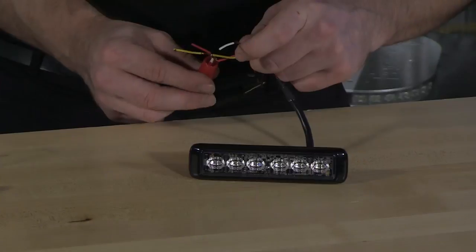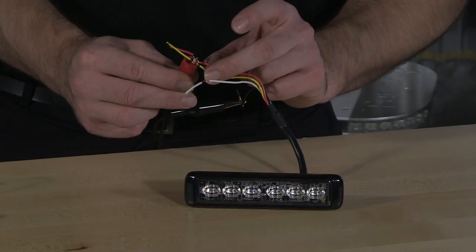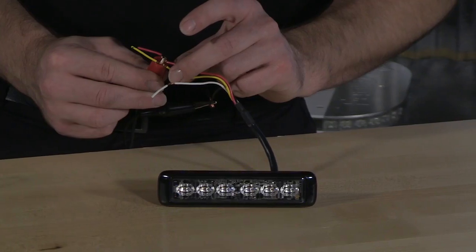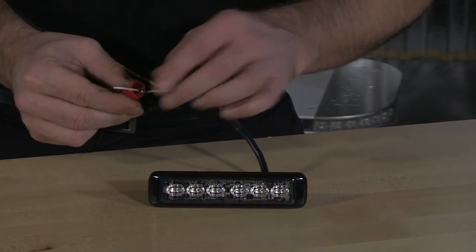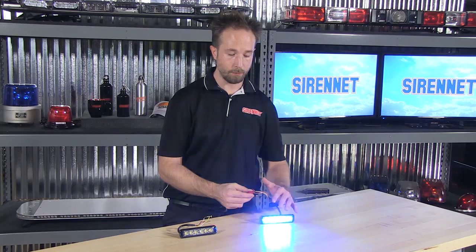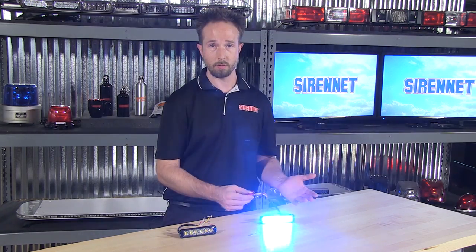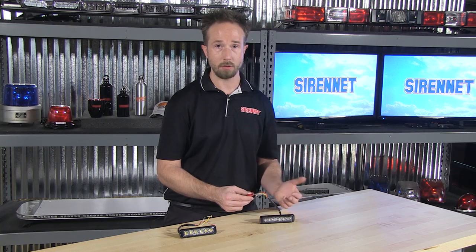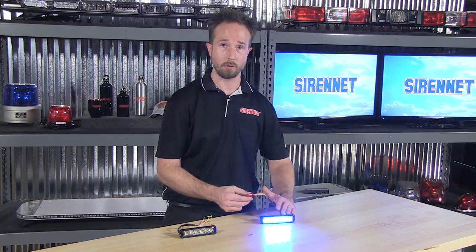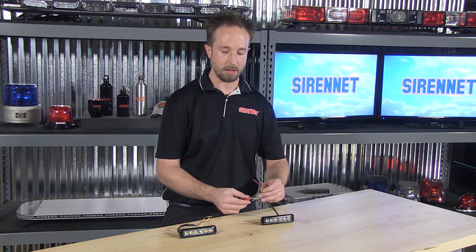So in this case, red and blue — power applied to the red trigger. If I want to make an advancement to the pattern, it can easily do so again with the yellow trigger wire. Positive 12 volts makes an advancement. When power is applied to the white trigger wire, it's going to go ahead and activate the other mode — in this case, isolating just the blue. So very useful. Depending on how you want to set up your vehicle, one color for running code three lights and sirens, another color to tone down the vehicle for position two or position one, you can do a lot of different programming with these. Two trigger wires — you can tie it into your main siren and lighting controller, using it different ways.